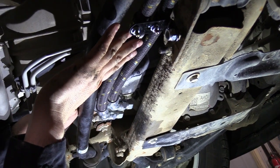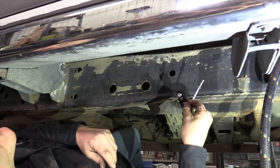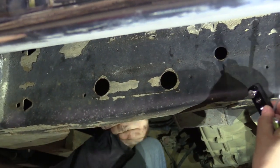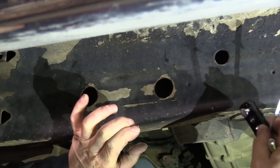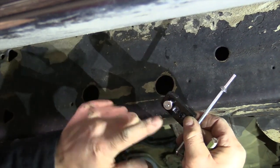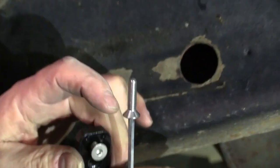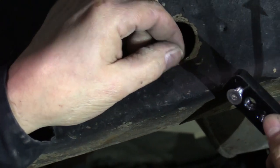That takes care of this bottom part and running the hoses here. We're going to start going back over to get the filter mounted. We're underneath the passenger side door — right here's the outside of the frame. We're going to use these two holes right here for mounting. It's a box frame — the holes go all the way through, but this frame material is still thin. If you try to bolt to it, the frame just starts flexing and you can't hold your bracket where you want it. So I made these attachment pads, and they have a specific way they go on. One side has countersinks — that's to allow the bolt to go in far enough to grab and bite into this frame right here.